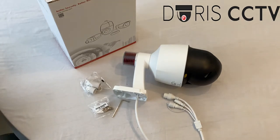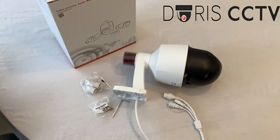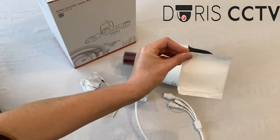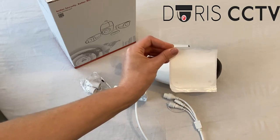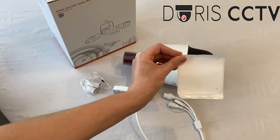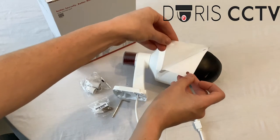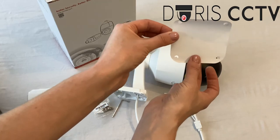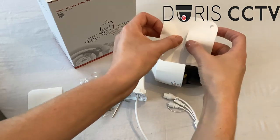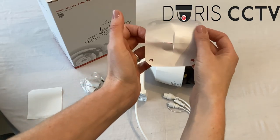Installation is really easy. You will need a power drill and a screwdriver. Locate the positions of the holes and paste the installation positioning stickers on the wall where you want to place your security camera, aligning the cross center to the hole in the wall. This is your mounting accessory — it's got four drill holes and a central slit hole as a guide, which is really useful.